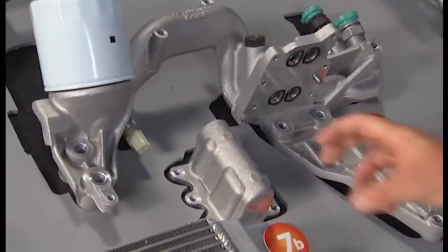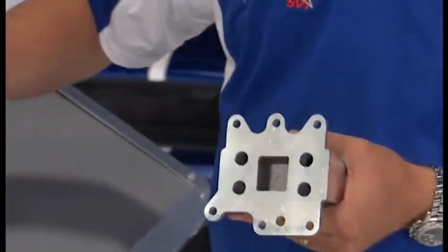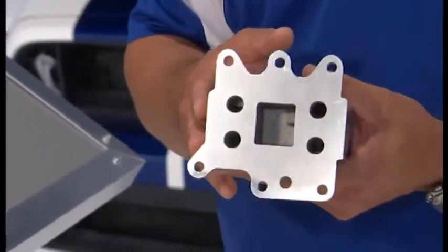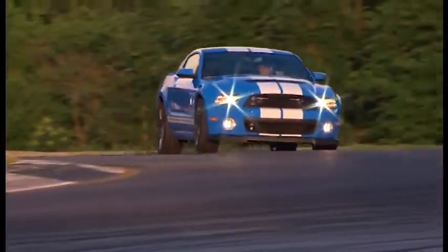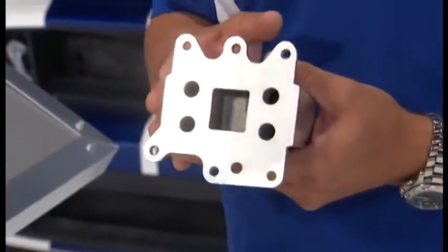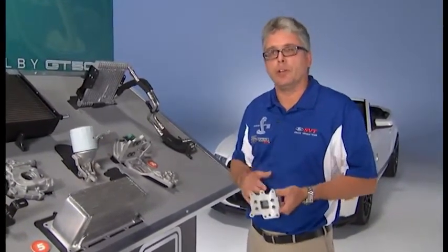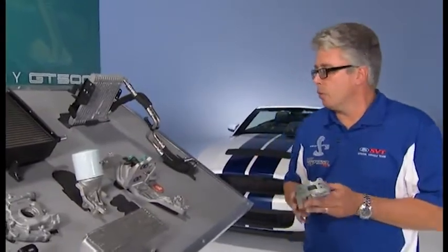When we go to the optional package and have this standalone oil cooler those circuits are separate, so that the engine coolant thermostat no longer has any influence over the temperature of the engine oil. In order to control the engine oil temperature we added an engine oil thermostat which has ports on the bottom that are connected to the oil filter adapter. An element in here senses when the oil is cold and bypasses the cooler assembly, allowing us to get rapid warm-up of the engine oil, and then this valve will open when the engine oil gets hot so that the cooler can then be used. One of the key reasons for having this is that if you operate your oil too cold you have issues with not evaporating both fuel and water that get into the oil — it's critical that you get your engine oil up to certain temperatures so that that water and fuel can be boiled off, keeping your oil clean.